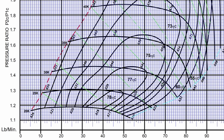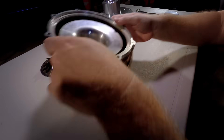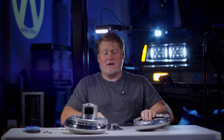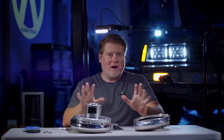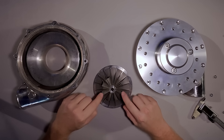Let's go take a look at the impellers and see what the difference was. I decided to pull the parts I had. The sledgehammer still lives on the LTD and I don't want to take that thing off — it's kind of a process. But I do have pieces and parts from other superchargers kicking around. Most notably, I have a Vortec volute, a Vortec SC trim impeller, and a whole other Speedmaster P2 supercharger. So we can compare these things. I can tell you that this is the original impeller we used in the electric supercharger testing, and this is a Vortec SC trim.